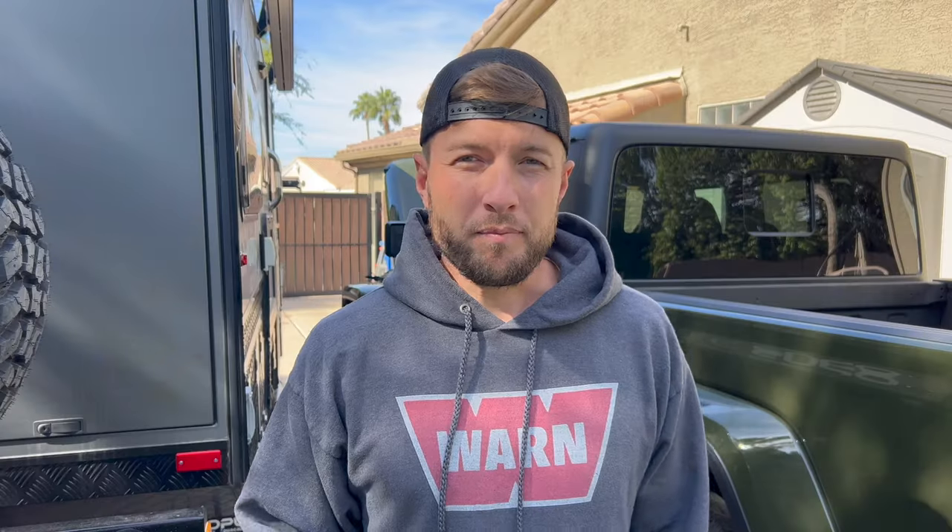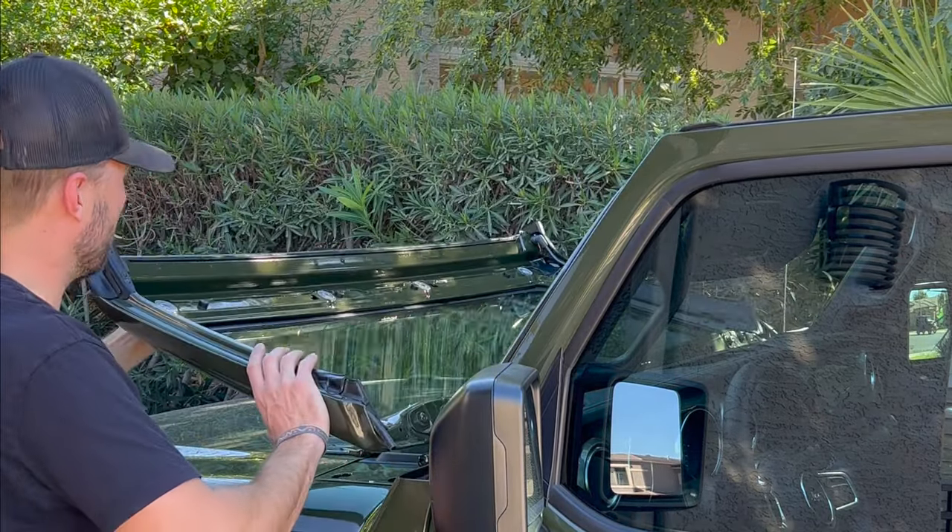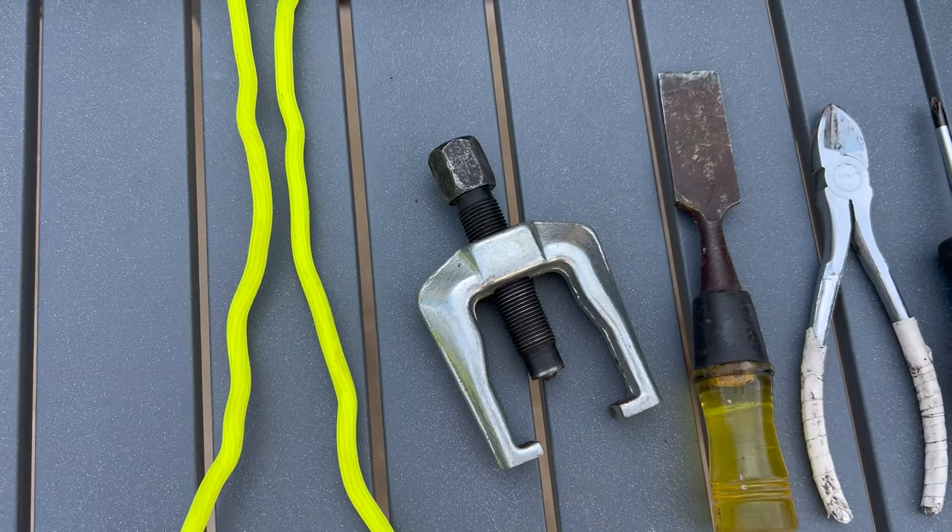With the e-Dock install, they have you lower the windshield, which you really do need to do. It also helps when you're installing the S-Pod for routing the data cable up into the cab of the Gladiator, so lowering your windshield is a must. When it comes to removing the windshield wipers, they're going to be pretty tight — at least mine were. I ended up using a little puller that didn't put a lot of stress on the windshield wiper mechanism. You can get them at your auto parts store and I'll leave a link below.